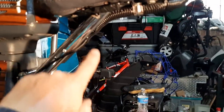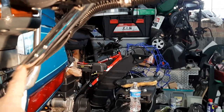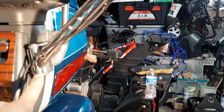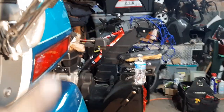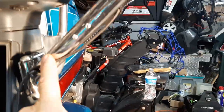The wiring comes out the bottom where I butt spliced it to a set of wires that I added, because the factory wire had a big plug on it and there was no way that the wire was long enough to go where I needed it to travel to. So I made my own little wiring harnesses, cut the plug off of the seat heater element, and fed my own wires up the tube and into the trunk that I drilled from the inside out to hide the wire.